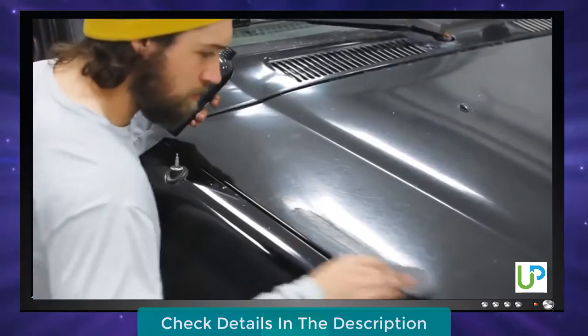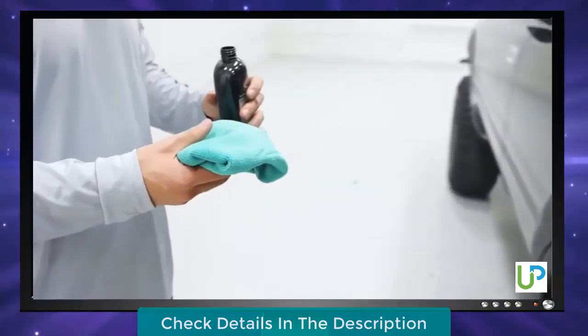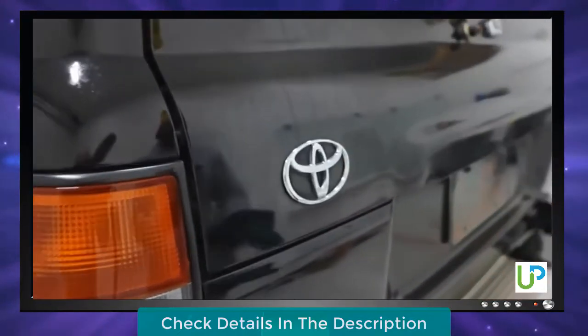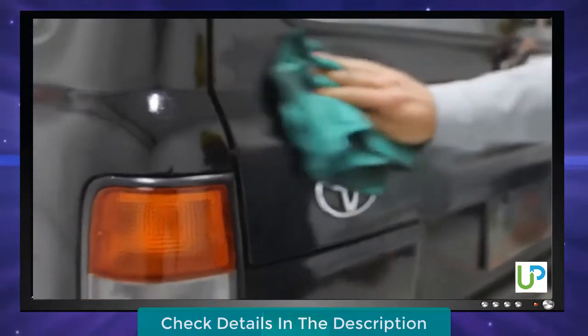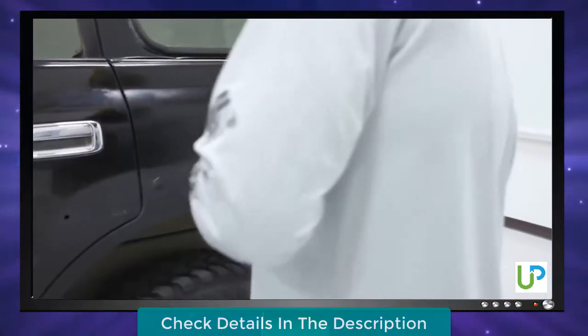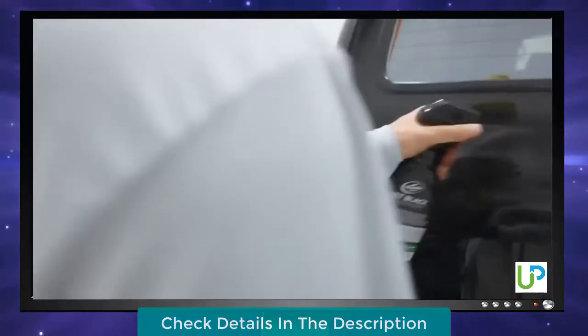With your car clean, dry, and out of sunlight, pour the pre-wax cleaner onto one of the provided applicators or a clean microfiber towel, and with back and forth motions, work into the paint section by section. Let it dry to a haze and follow with a Jet Black spray detailer, sprayed onto a clean microfiber towel or directly onto the surface to be wiped. Continue these same steps again in manageable sizes throughout all of the car's panels.